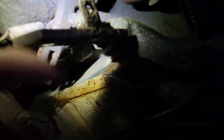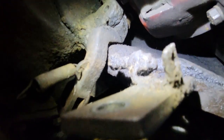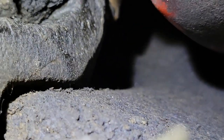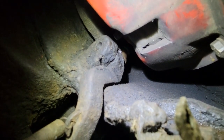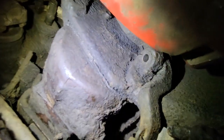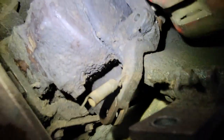Just crawled under here to put the clutch slave cylinder in. I was curious about the bolt that holds the clutch fork in so I took that out - now I can't get it back in, but that's fine because I have another issue. Broke the clutch fork right at the pivot point. It's not an unheard of issue with these things - I guess I just put too much torque on the pedal and she went snap. That's probably what that funny noise was when I was pumping the clutch. Looks like we're pulling a transmission now. Fortunately these have tiny little transmissions and transfer cases.